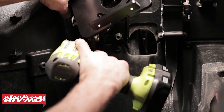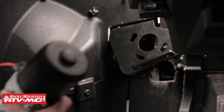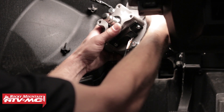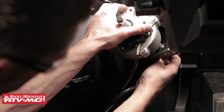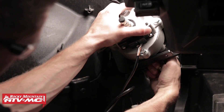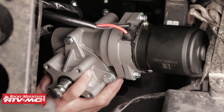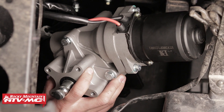Take and re-thread the four nuts that we removed earlier. Next, we can grab the steering motor itself. We're going to take three of the larger fasteners and place this onto the power steering bracket. With the power steering assembly loosely mounted, rotate and adjust the position so that it has sufficient clearance.